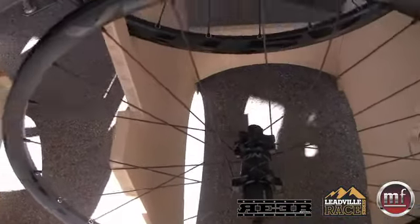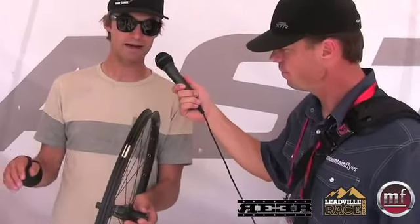The Vice XLT is $750 MSRP. It takes the exact same rim as the Haven, so it's fully sealed tubeless with all the benefits and the nice wide rim. But we lace it to a more affordable, slightly heavier hubset — that's how we get the price down. It's still very durable. It's also worth mentioning we've had an overhaul on Easton hubs in the last year. We abandoned our preload adjuster, which was a source of headaches — it wasn't adjusted properly, or it was loosening up while riding, causing premature bearing wear. We saw that as a problem and fixed it. We don't have preload adjusters on any of our wheels now, and we're offering a retrofit kit for anybody with Easton wheels — they can contact us and get a kit for free.